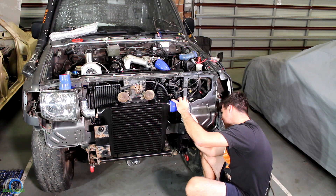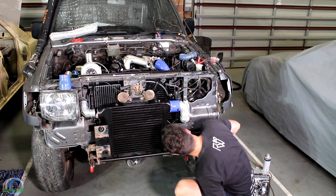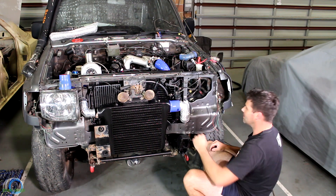I've made my second little 90 here and I've also welded a bit of straight on. I'm just going to roughly guess where it is. After making another pie bend at 90 degrees, it's ready to weld these together — it's just a repeat of the first: tack both sides of the pipe to stop movement and then lay a bead. She's close — look at that. Yep, fits in, with a heap of room around there.